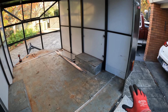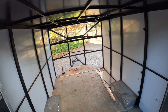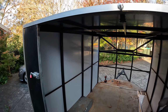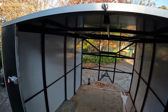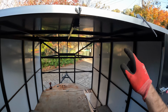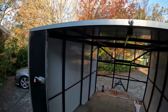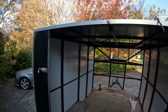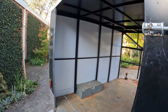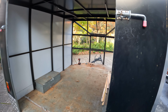and then do a bit more of an interior lining so that there's also some hanging area available. We're also going to do the two runs of lights on the ceiling. They'll be wired in. I'd like to potentially put a battery in this trailer so that there can just be a switch for on/off for 12 volt lighting. Those LED strips are 12 volt lights, so it'd be nice just to be able to work in the trailer at night time, depending on what you're doing, and have some sort of lighting, because we all know how difficult it is when you don't have lighting. So that's the basic rundown.